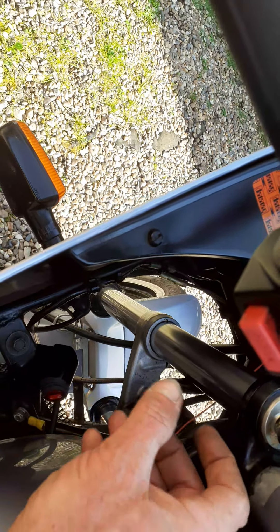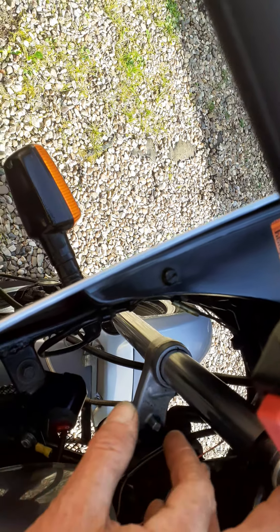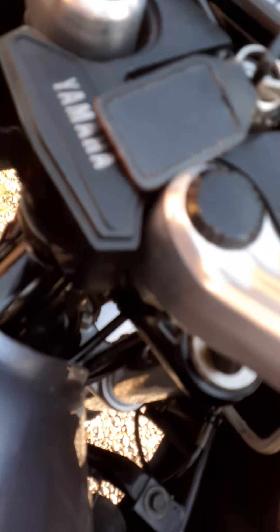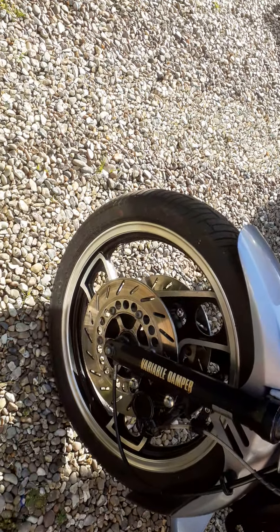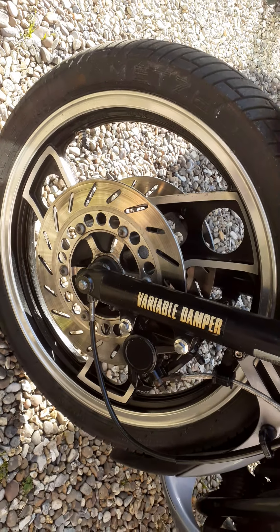When I changed the fork seals, on this one I needed to loosen the top and bottom nuts and just spin that out a bit. I didn't bother repositioning it again after I realised my mistake — that one's in the right position, this one's turned in slightly, but at the end of the day we put slightly more oil in the forks than the recommended amount — only about 4 millilitres — and that is absolutely bang on. You don't need to top it up with air, though you can if you want, but it does make it quite hard.